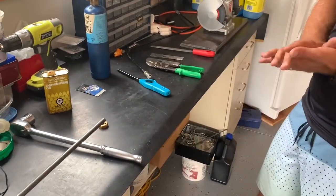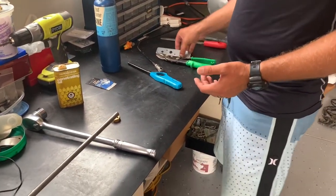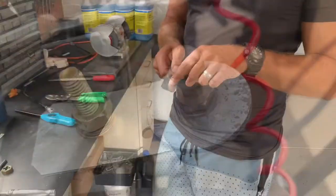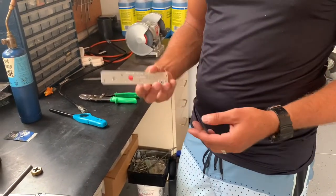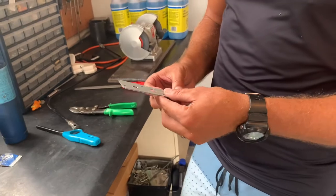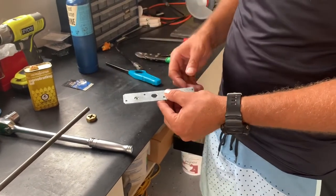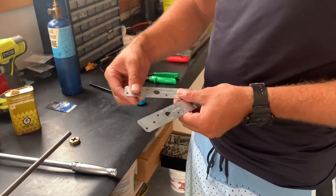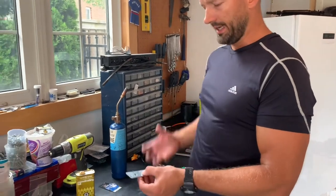With the actual ball joints themselves, we already had one on our main motor so we didn't have to do anything with it, but we needed to put a bracket on the kicker motor — if you look back to earlier in the video you'll see a bracket attached to the kicker motor with a ball joint sticking off it. I picked up these decking brackets from Home Depot — I got thin ones but I'd recommend thicker ones. I lined up where I needed holes drilled, used some of the pre-drilled holes, and used two brackets to make it stronger because with one it was flexing when I tried to steer. Then I put the ball joint through the hole and assembled it, attaching it to the motor.